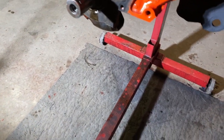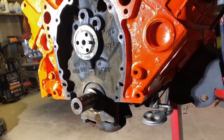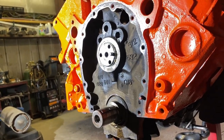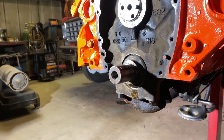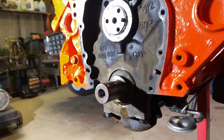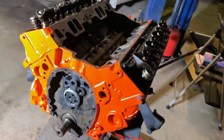that's not good, obviously. So I went to my buddy's house, GM Nut, and I got some double roller set. I got another single roller set. We're gonna try it, see if anything's different. And if it's different, then we know we got an issue. An issue being the block was line bored, anything. Literally, it could be anything. So I'm gonna try another set. We're gonna see what happens. So if you see me swapping chains, that's what I'm going through right now. So bear with me, but